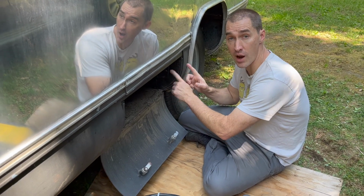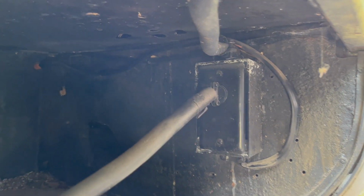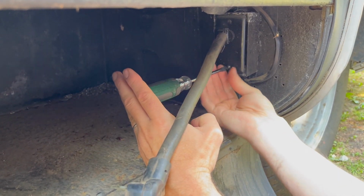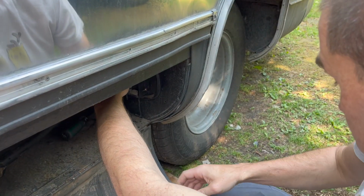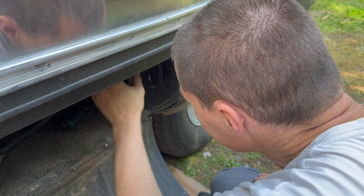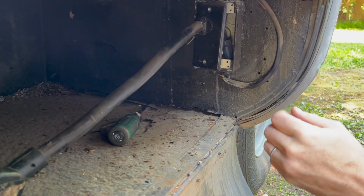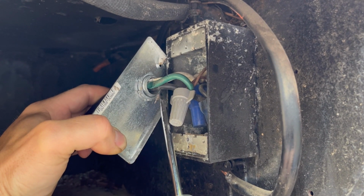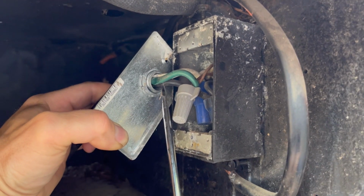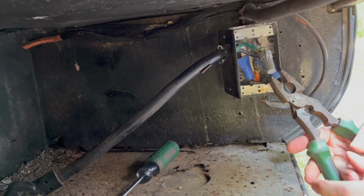I'm going to undo this wiring because it's pretty unsafe. I am now going to take off this outlet plate and see how these connections are made. It is so buggy. I know that parking in the sun would be hot, but it might actually help us. Maybe. Oh my. Yep. Right here, it looks like the wire's been chopped into by something in this cover, and that's a little bit dangerous. Well, it's through the insulation. That's not good.